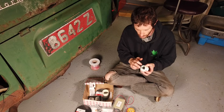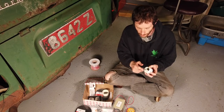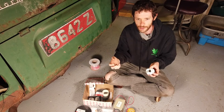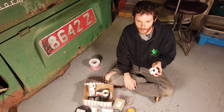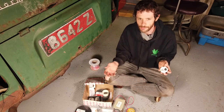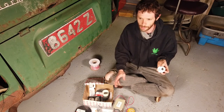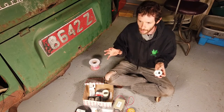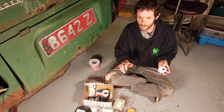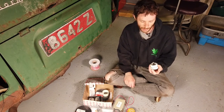You need to basically run a wire from the sender probe, which is screwed into the sump — the oil sump on the bottom of the engine. It's not really the best place to get an idea of the temperature, but we're only trying to get a rough baseline of what's normal for the engine. If you really want to do it properly, it involves drilling holes and tapping out holes in your engine case, and that's not something I want to get into.